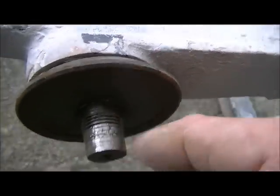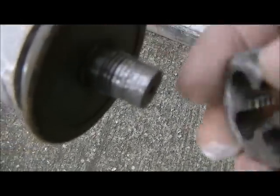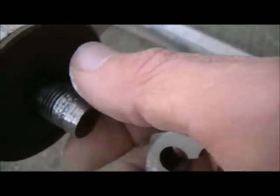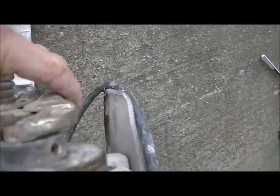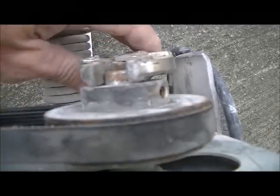There's about a quarter-inch discrepancy where the washer goes on — I have a large washer that goes against the blade. The blade and the washer would take up that space, and then theoretically the new nut, which will be a half-inch nut, will slide right on there. I also got some vice grips on the spindle right here that's part of the motor, and that'll stop it from turning when I start turning the die — so I won't turn the whole motor.